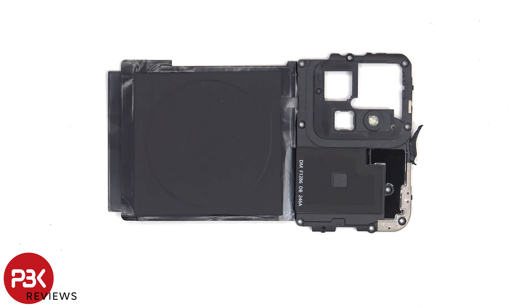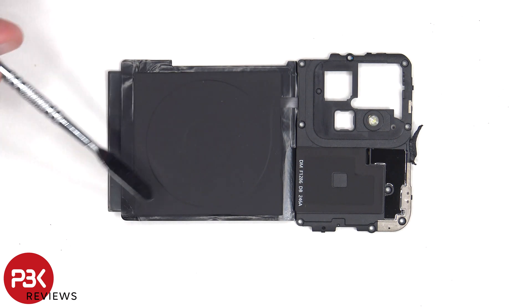There are some antenna lines drawn on the top plastic cover, which are the light gray color lines. The NFC antenna is located here and the wireless charging coil is located over here in the center. There are also multiple layers of graphite film to help transfer heat.